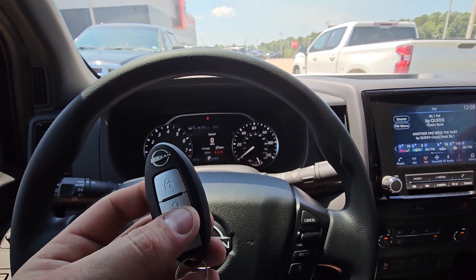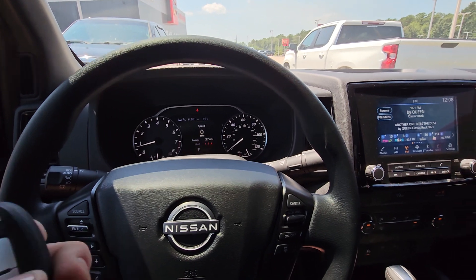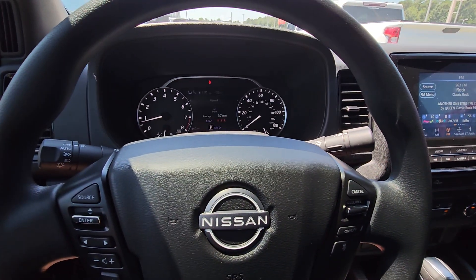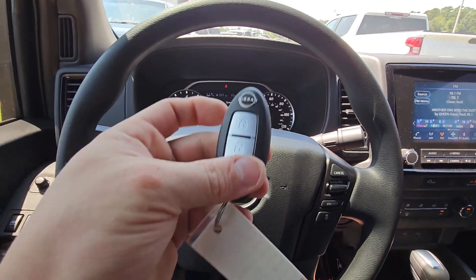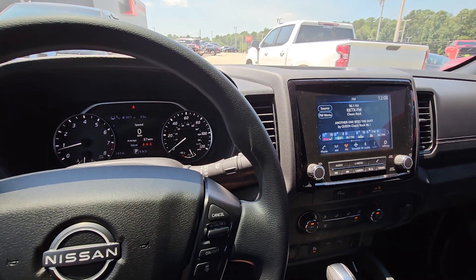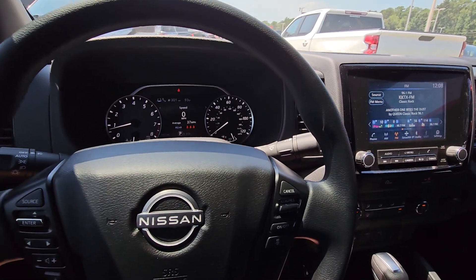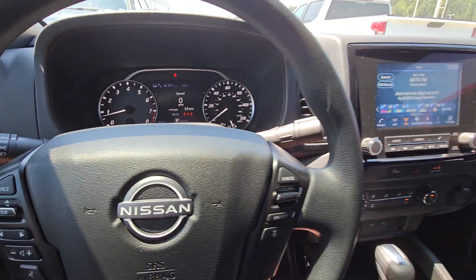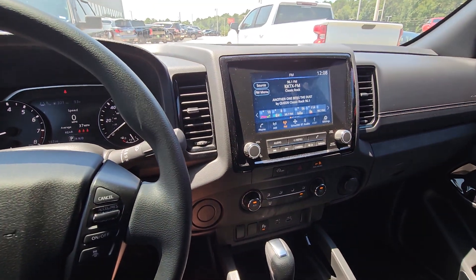Now this particular system, like the Nissan Titan add-on system, is hit and miss on the AC compressor cycling. It will turn everything on and blow air, however there are certain limitations that may stop the AC compressor from cycling without the physical key in the truck. So it's fantastic for heat, but hit and miss on AC. It's unfortunate, but it's part of the firmware, so nothing can be done on the remote start end for that — at least that we've found so far.